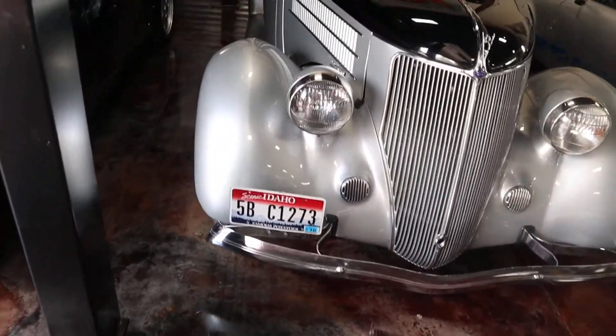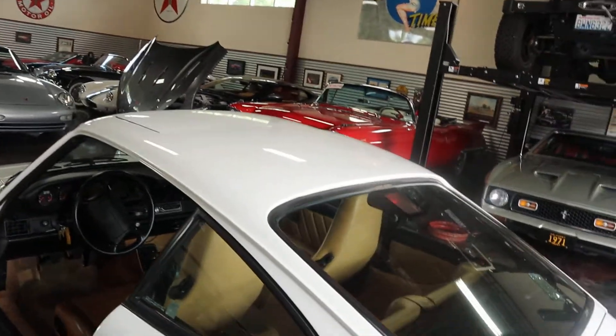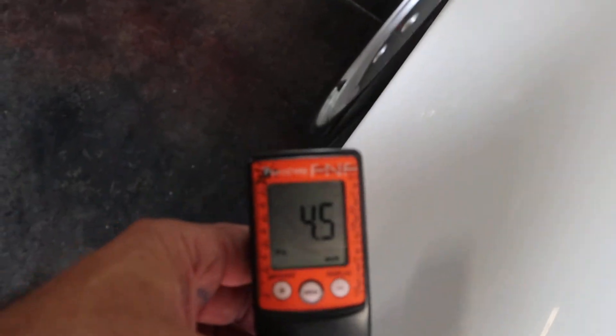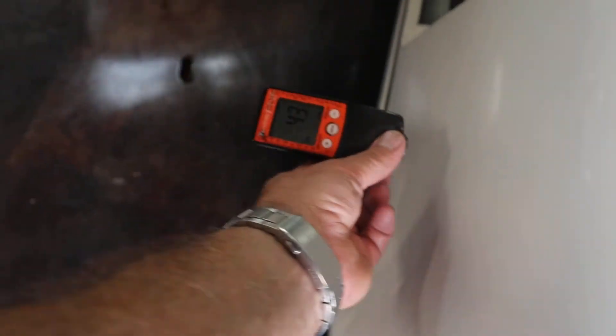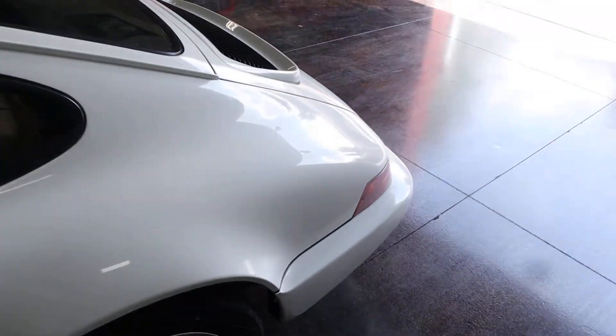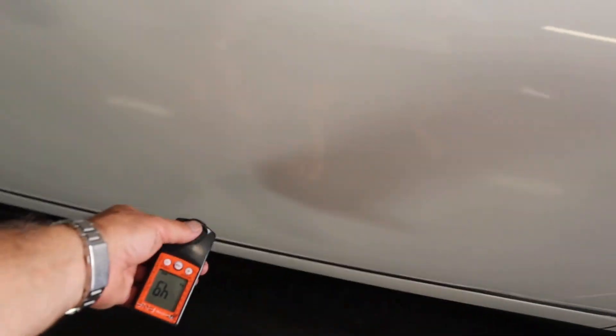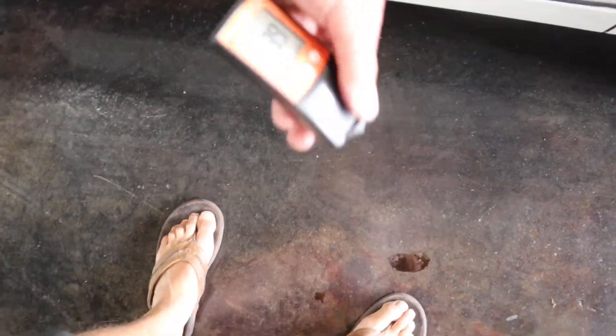Some of these classics, you'll see readings in the 50s, 60s, teens — some pretty high readings out of the older cars. But we'll just keep cruising through this. Readings of 4.5, 4.3, 4.9. So if there was something done there, it was super light — certainly no Bondo. Repaint levels only on the doors. Reading 3.6 — that's a factory reading. 3.9.